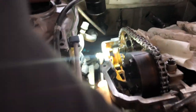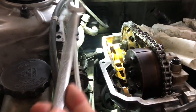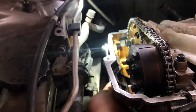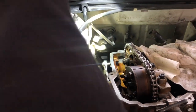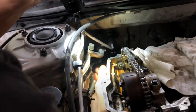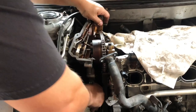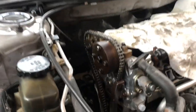Get a wrench — it's a 13 metric — and the back nut is the one that's going to drive that stud out. I switched to a ratchet wrench, and here we go, that stud is coming out now. I didn't have to loosen up the transmission mount on the driver's side — there's just no reason for it. The stud won't come all the way out, but now I can get the cover out. Just takes patience, and the cover came out. Hope this video helped.